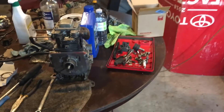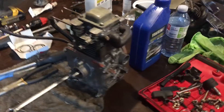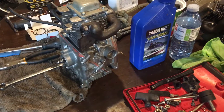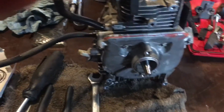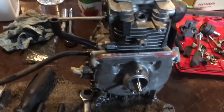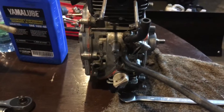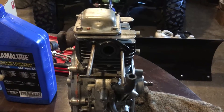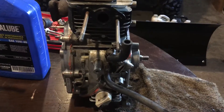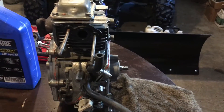Anyway, we got the motor portion put together — it comes apart in three pieces. We got a brand new crank put in, new rings, all the gasket material scraped off and new stuff applied, cleaned up, timing set, and valve clearance set. You want no rattly-rattlies or ticky-tickies.